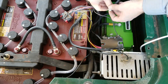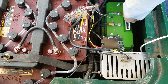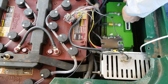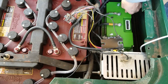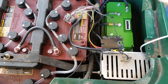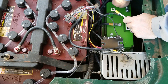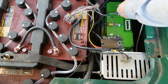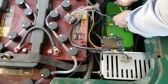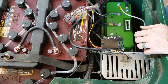Now that we've got our motor cables hooked up, we're going to hook up our battery negative. I do have two-gauge cables, so I'm using the cable I already have rather than the one that came — there's a longer four-gauge cable that comes with the golf cart for this connection, but I'm going to use my two-gauge. I'm going to go ahead and hook up the resistor cable to the resistor. This is the lengthened resistor cable that came with the kit — I'll just thread that right through there and tighten those up.